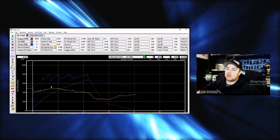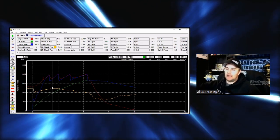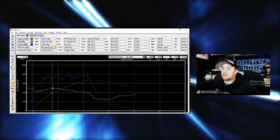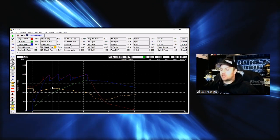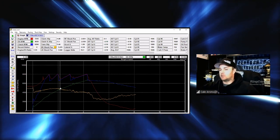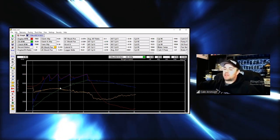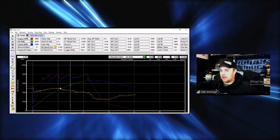So what we're looking at here, on these cars, and different people have different theories on this, and I've played with them all, but to give you an idea, the way we run this is, see, we're coming back up close to ride height somewhere in about the first part to the middle of second gear. And with our stuff, obviously, we start obtaining enough actual ground speed on out here. You can see it starting to push, and as we go out here, it'll start to push the rear end back down. That's obviously from downforce and the speed of the car. Because by third gear, we're running well over, say, 120 to 130 miles an hour really easily.